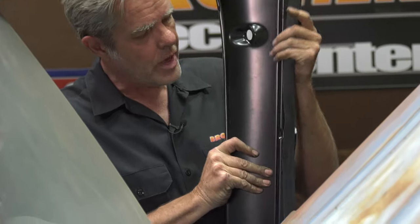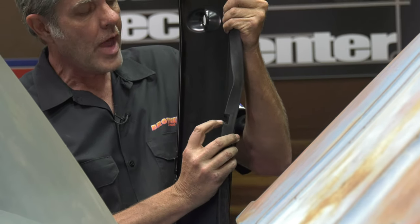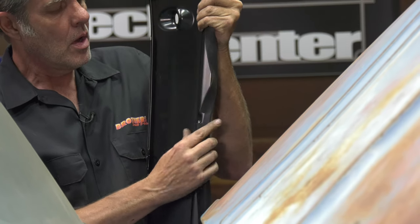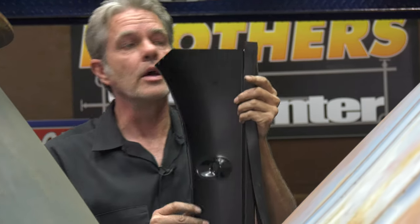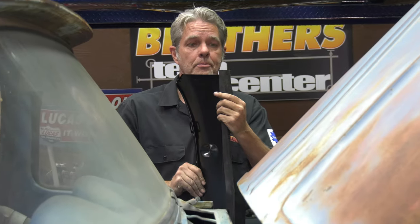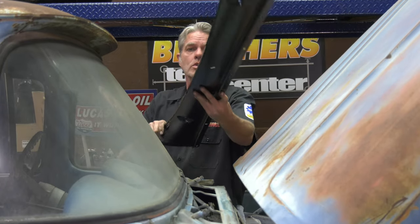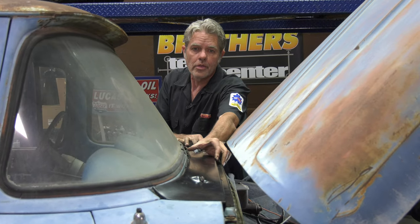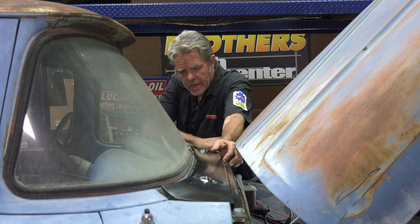You want to notice that there is a notch right here in the rubber — can you see that? And that notch is going to line up with this indentation in this piece. You'll notice the rubber will be a little bit taller than the piece; you can go ahead and trim it down if necessary. Now I'm going to go ahead and install this guy here — it just goes on just like it came off. We're just going to slide it on, get it over the wiper arm holders, and get it on the tabs.